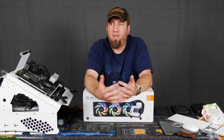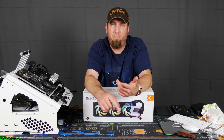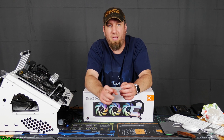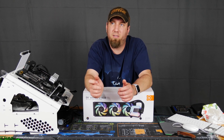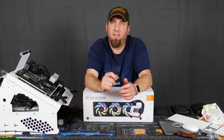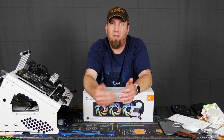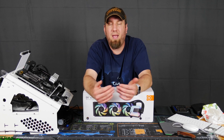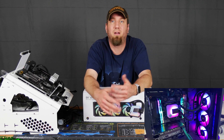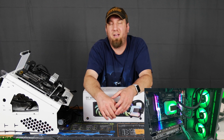As for the DRGB, I really love that. I took all the DRGB cables off the pump and the fans, and on my case — the Phanteks Evolve X — it's got a DRGB cable that comes out for you to plug other stuff into or to plug into your motherboard. I started with all the fans first, plugged those in and daisy-chained them off of each other, then plugged the pump into that. So they're all daisy-chained together and able to use the controls off of my case.